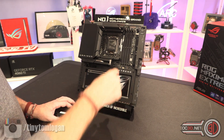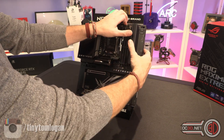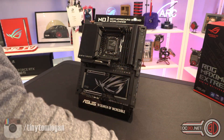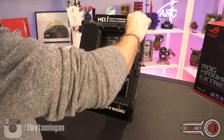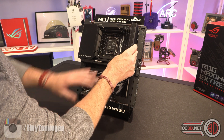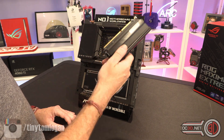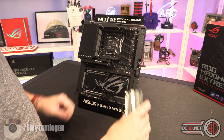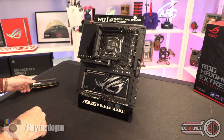It's all good - there's nothing bad about Nitro Path. They're gold plated and everything. The fifth slot on the end is this extra add-on card here that you can run if you want. Effectively this is a bolt-in for two further NVMEs. The only thing I will say is this does give a very big airflow block for your DRAM slots, depending on your configuration. As nice as this looks, I'm probably going to use my board without it, because even if you had four DIMM slots populated, this is going to look a bit out of place. I've always wanted Asus to have a blank for this - some 3D printer wizards out there could make something for Etsy. I certainly would buy it.